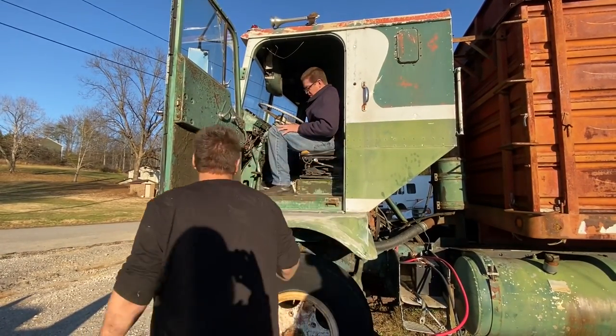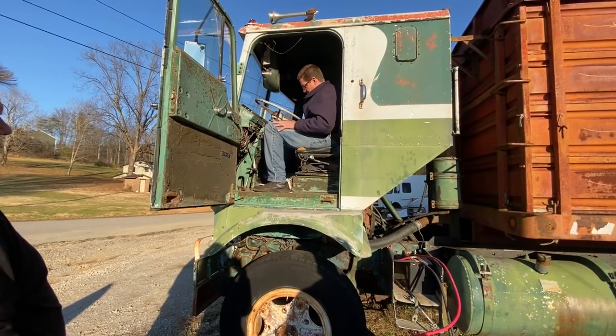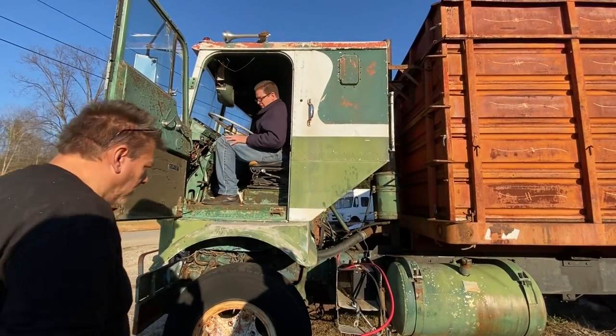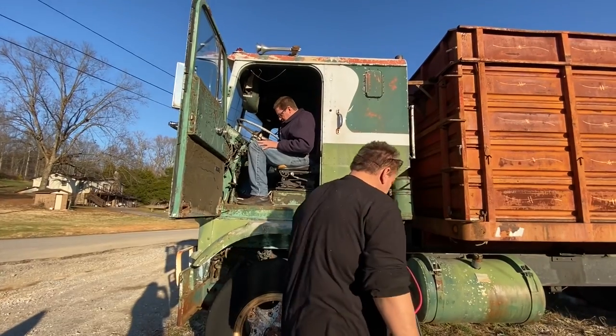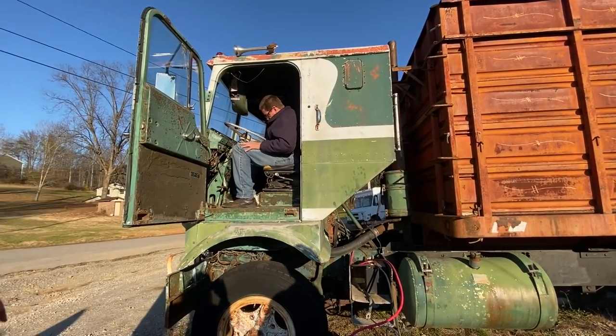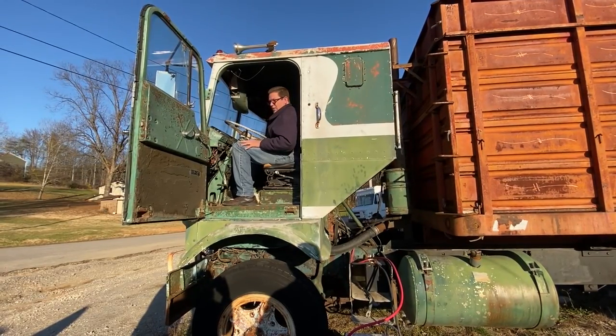I guess we could tilt the cab back up, start it, and manually rev it up and see if it stops the problem. Well, I know it will, because that's how I was manually doing it. So the problem is between the throttle pedal and that. You're inputting the throttle with that shaft, and it's not allowing it to return back. I'd say the problem is that spring.